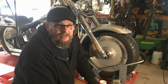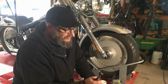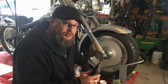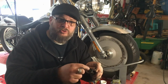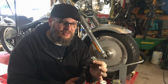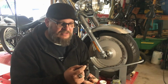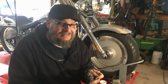So I'm gonna go back to the drawing board and see if there's something else that I can do to help shine that up. Things to note when using this, since it had the screw going through, since we switched from the little screwing kind, which had this little screw tip, to the one which has, you use a little jeweler screwdriver to screw it down into it and putting the hole through this pad. I like this much better than I like that little screw tip thing because the pad would eject off of this. But be very careful when using this that you don't have this part of the Dremel or that part of the Dremel hit anywhere on your fork because it will scratch it.